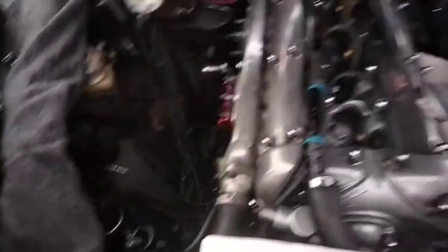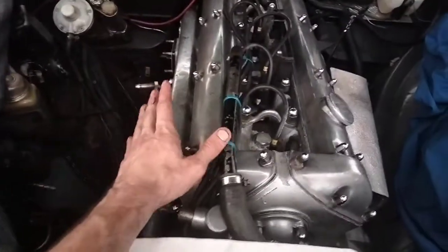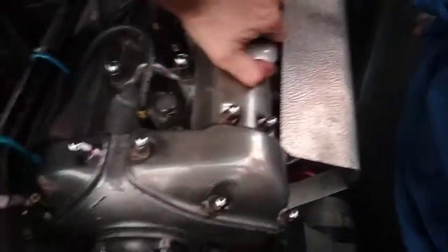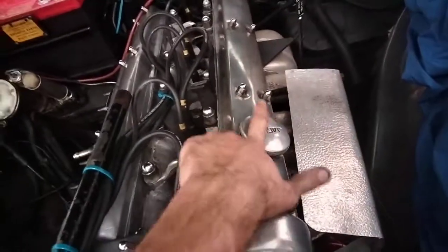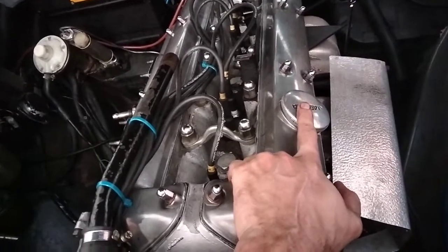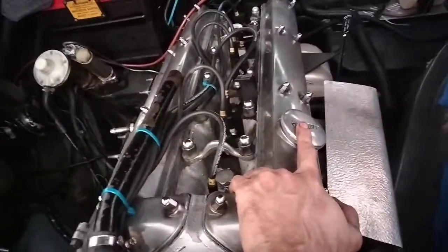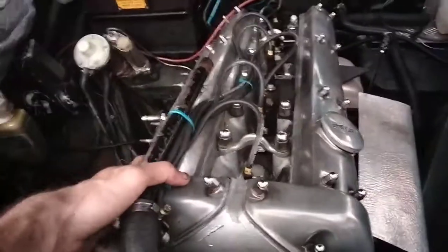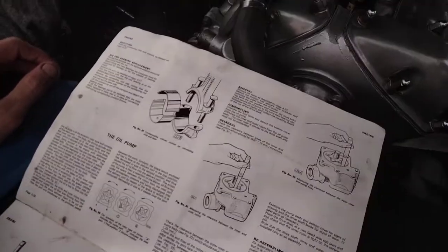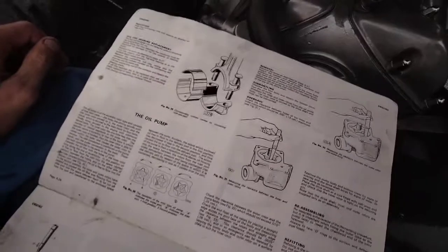The first thing I did was check — I've just set all the valves in here and I thought maybe there's a chance one of the main bearing caps has come off. Silly idea, but I pulled these covers off and there's still plenty of oil in there. I was looking in here — you can see the camshaft and this bearing, and there's still enough oil coming through that bearing that I was satisfied it wasn't losing flow. So even though the pressure gauge is reading very low, there's still enough to lube the top end. I was holding it at two to three thousand RPM on the highway, and that's probably the best thing to do — definitely not idling. At the very worst it could be bottom-end rebuild time, but a set of bearing shells is about 60 bucks and might take me a couple of days.